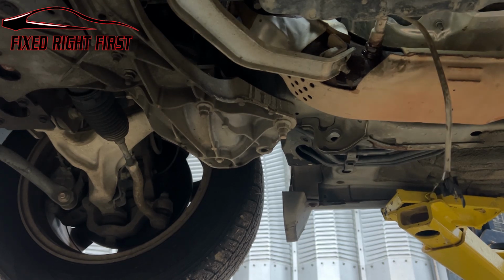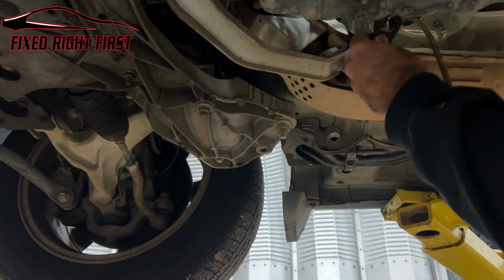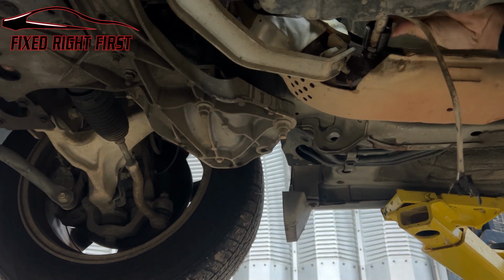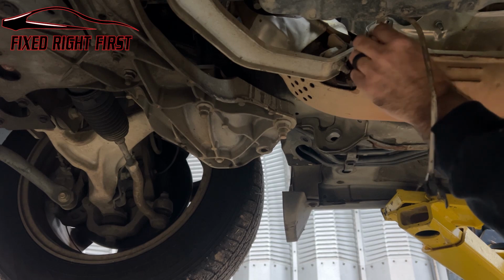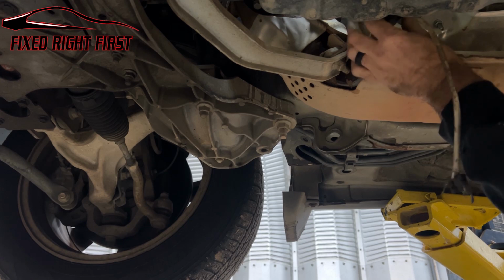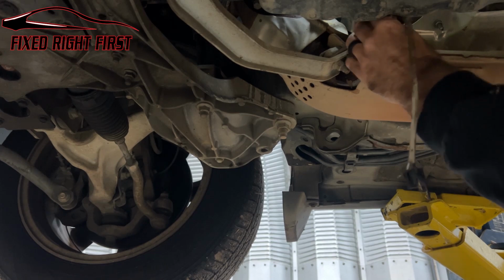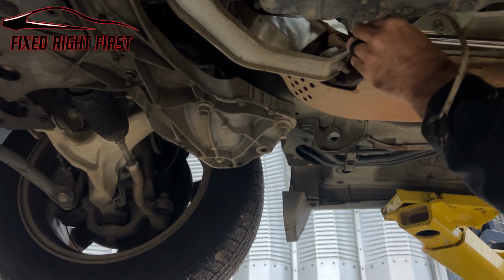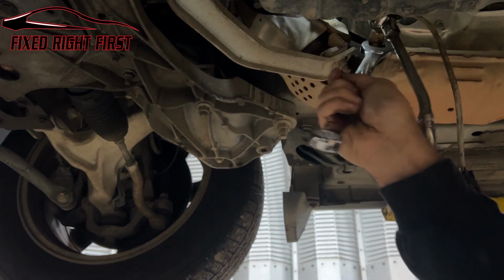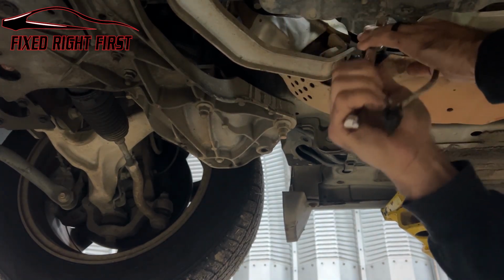So when doing this job, they actually have oxygen sensor socket tools. You can get the socket that has a hole or a line through it so it'll go over the wiring harness. Put that kind on there. They have them that come with handles already attached. This is a Snap-on. Go ahead and put it on. If you don't have either of those, a 7/8 wrench will do the job. So, since I have a socket, I'm going to go ahead and pull it on.